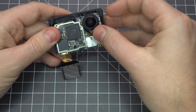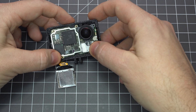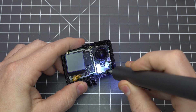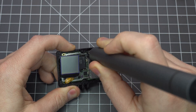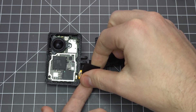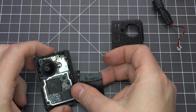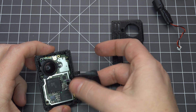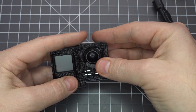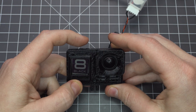Carefully feed the back of the sensor through the back of the case and slide the main board into position. Pay attention to the metal standoff in the corner so it doesn't snag against the camera lens — you'll feel it when you've got it. It should just slide snugly into the case. The kit comes with two types of screws; here you'll want to use the shorter ones in these five particular mounting holes. Now you don't want the display to cause any shorts, so cover the back with electrical tape. I had a really hard time getting this display working properly, so this may require a little trial and error. The case positions the display a little too low, so I needed to apply a small drop of hot glue under the ribbon cable to prevent it from getting pinched. It's also a challenge to get the display level, so don't screw everything together before you test it.